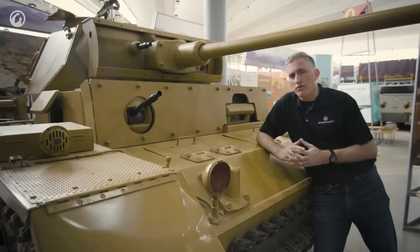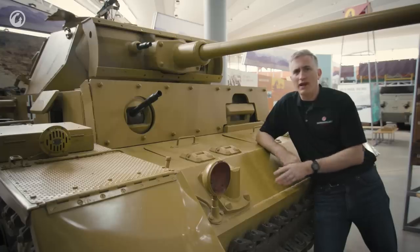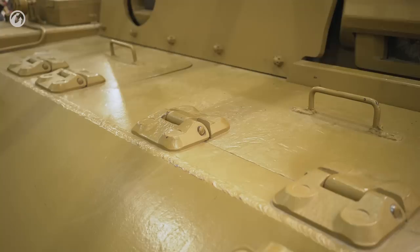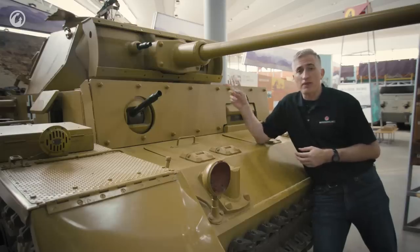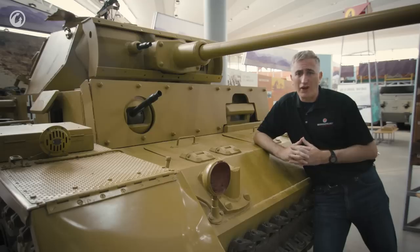Warfare accelerated development significantly. The 15mm of the first Panzer III gave way to 30mm on the first mass-produced tanks, and by the time we get to this L model, the front plate is 50mm thick. Even then, this tank has been given an additional 20mm of Vorpanzer, which is spaced armor. The bracket for the mantlet Vorpanzer is present, but manufacturing issues led to many vehicles being fitted for, but not with, the armor.